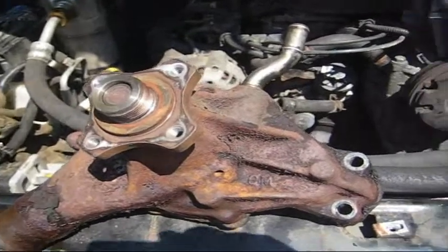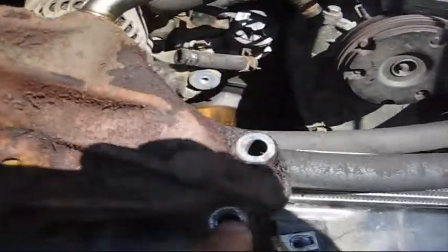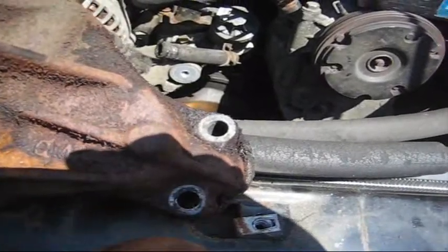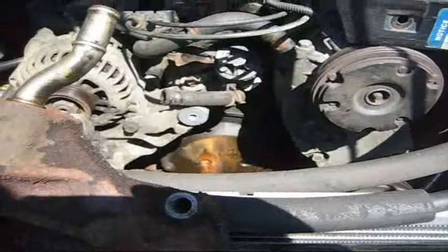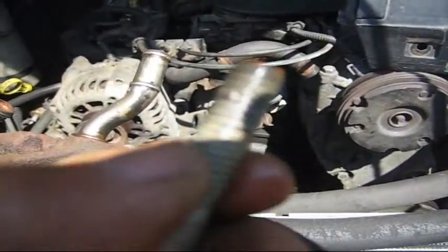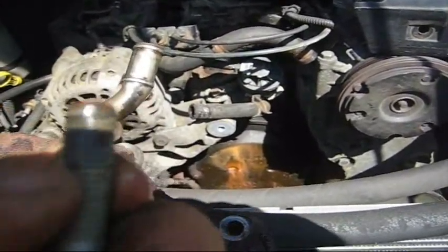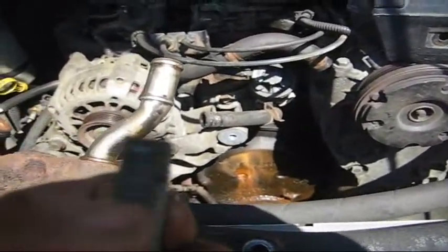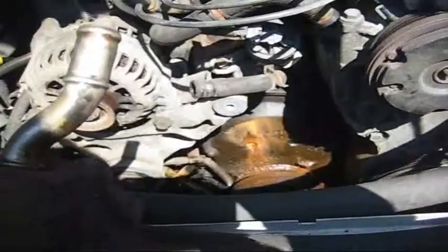Well guys, it's off. When I removed the 4 bolts, note, this bolt down here, water came out. So the bolt that goes through here goes through a water jacket. So you want to use some sealer on this thread over here. I don't have the manual, but I'm sure if you bought new bolts, the sealer would be on it. So if you want to, put a little sealer on all these bolts.